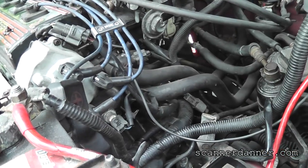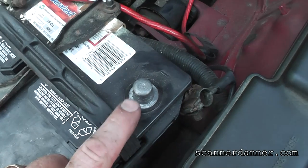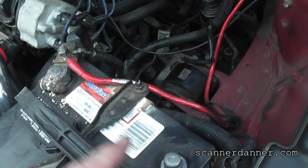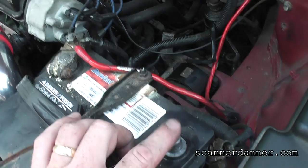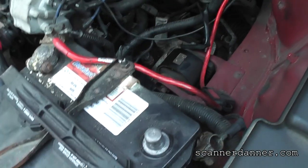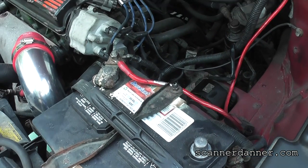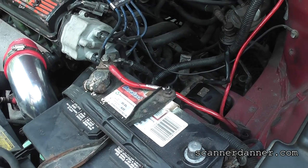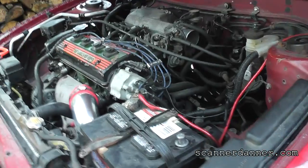All right, let's get our electrical connections underneath now. And by the way, we do have our negative terminal disconnected, because that wire that's down there is hot all the time, so it comes off of this side. As long as nothing's connected to the battery, no danger of anything. And there's really no danger of electrocution. The danger would be in that wire arcing and, you know, getting burned. Yep. All right, get under there.